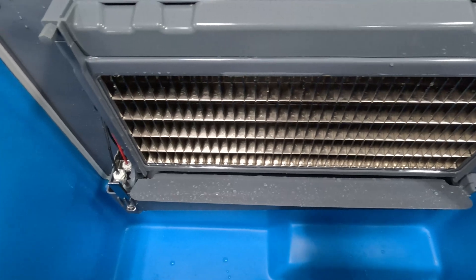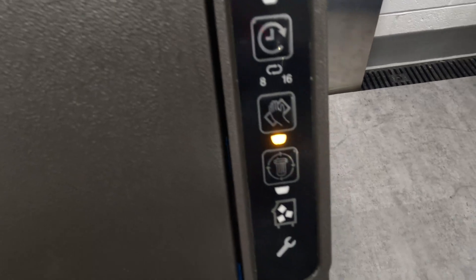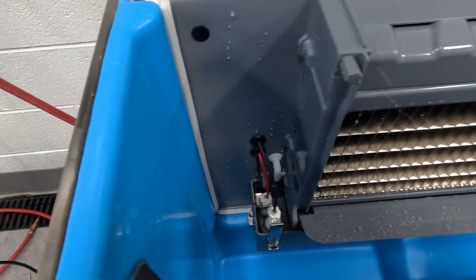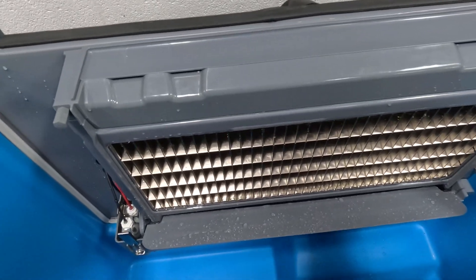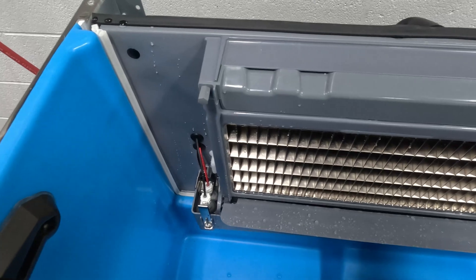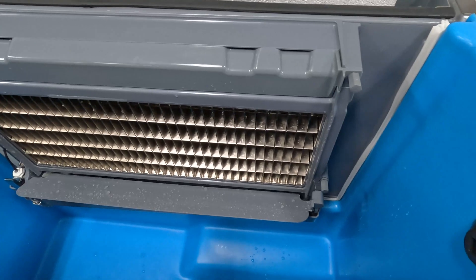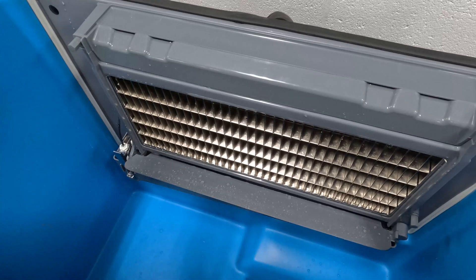Our machine has circulated the water for 10 minutes and then attempted to dump. We're in a fault — we know that because our clean light is flashing. If we take a look down inside the water pan this time, it's still full of water. At this point we're going to diagnose what's going on — whether it's a clogged drain outlet, could have a bad dump valve, could have a control board not sending power to the dump valve, or could have a harness between the two that's losing power somewhere. You're going to go ahead and diagnose and figure out why you're not able to get water out of the machine.